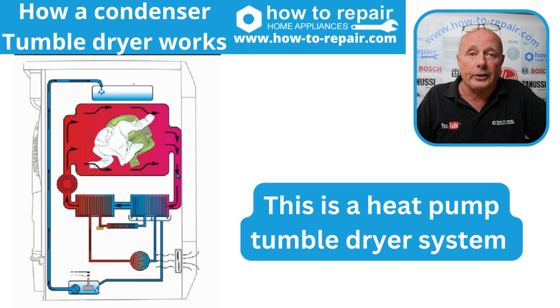It is less efficient than a heat pump tumble dryer. Although I'm a firm believer in heat pump technology, which is a refrigeration process used to heat the air going through the drum and condense it on a condenser plate to collect the water, the reliability still is not quite there. Most engineers will tell you when something goes wrong with a heat pump tumble dryer, they are very expensive to repair, because they are a refrigeration process.